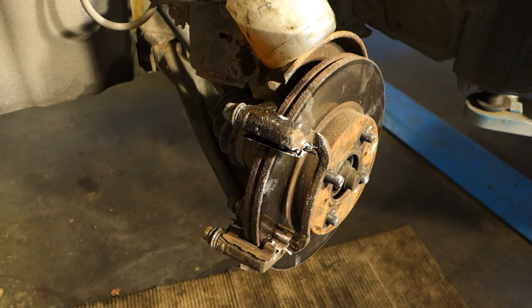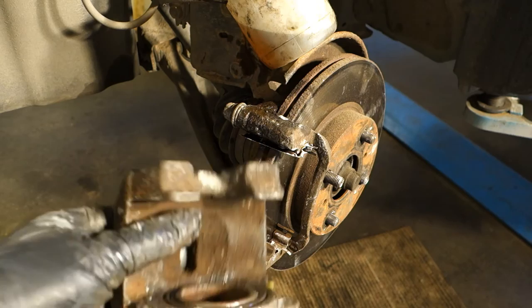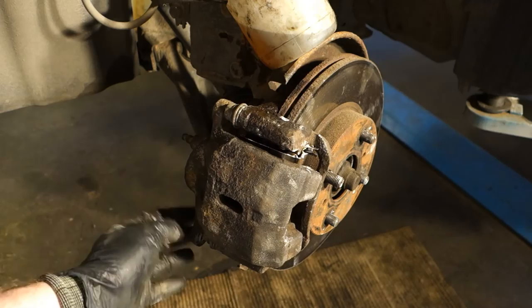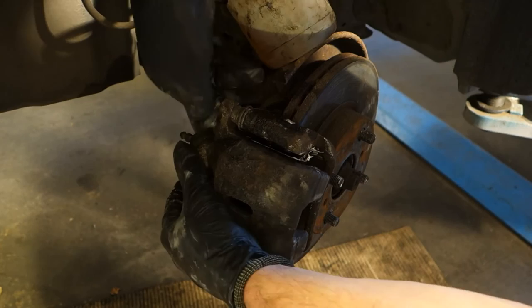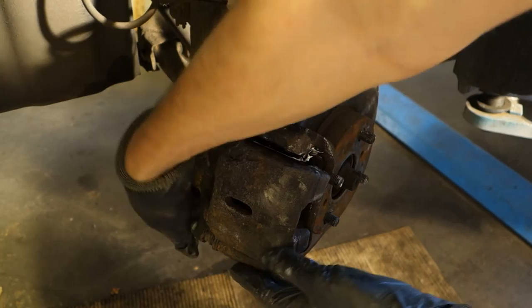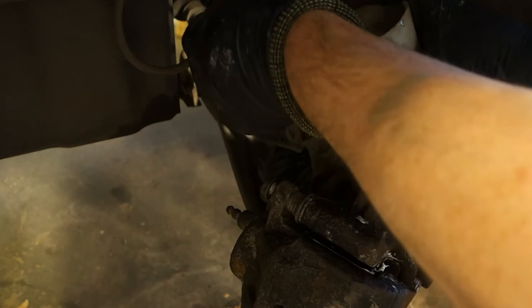Okay, and then I am planning to install this brake caliper back in here. And here is my brake caliper, and first I need to insert my brake hose back, and I insert a couple of bolts in there so that it is in position in that way, and second in here. Then here is my brake hose, I take that in here, and it is by the way full of brake fluid.